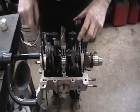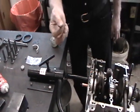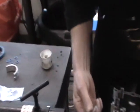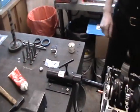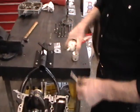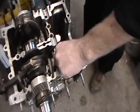Connecting rods are facing down. This is the gasket for the flywheel, but we won't get to that until later — I did mark it because it only fits one way. At this time we may as well put some of these lifters in. This is a good time to do it because you can't get at them later.